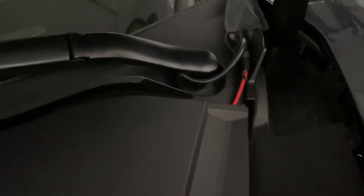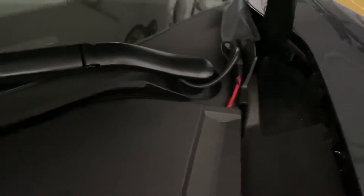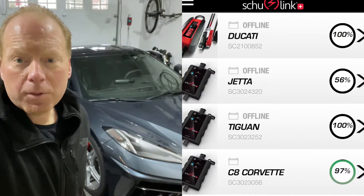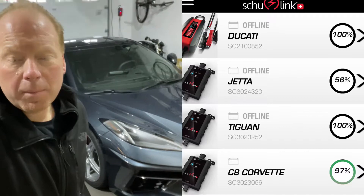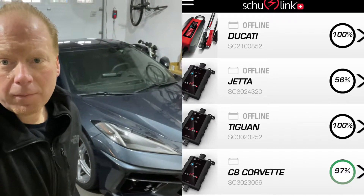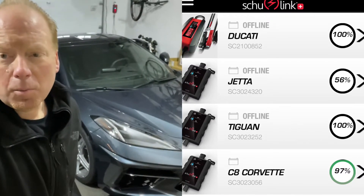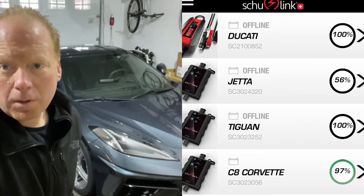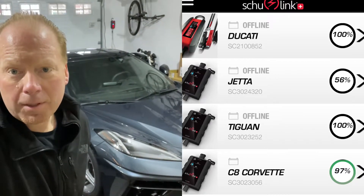Here's the final installation spot of the SAE connector right here next to the windshield washer — you can pull it out and insert your SAE battery charger maintainer. I've got these SAE link adapters installed in all my cars. I can just check it once in a while and see which car might need a maintenance charge or it's time to take it for a drive. Once they hit below 50-40 percent, it's time to take it out or hook it up to the maintainer.